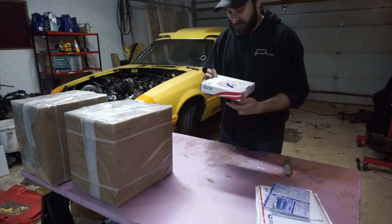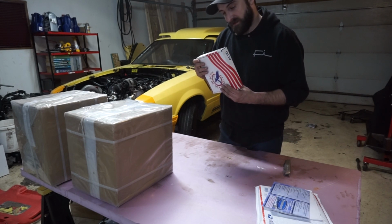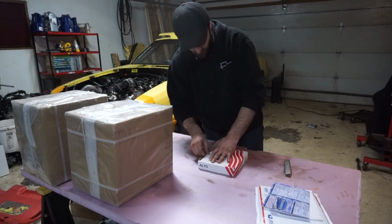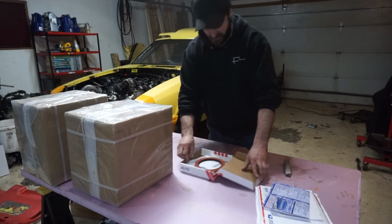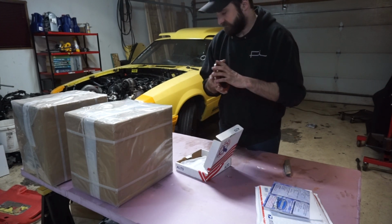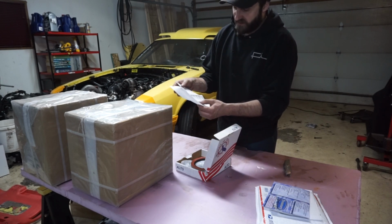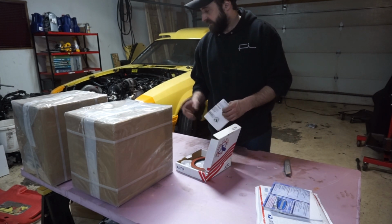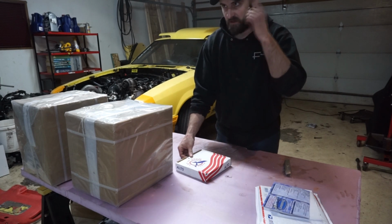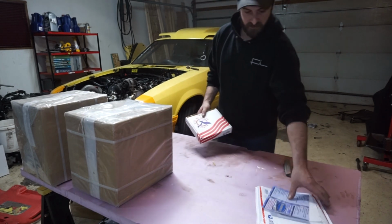This is another set of the power pack clutches. And it doesn't say on here which drum it's for. But here's 1, 2, 3, 4, 5, 6. So maybe this one is the forward. So this is the forward clutch pack. It has 6. The direct has 7, and then I'm not sure what the intermediate had, because we didn't open it up and I don't remember. But it has 1 more than normal, which I think is 4 or 5. Not sure.